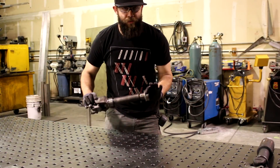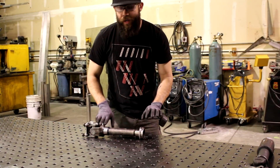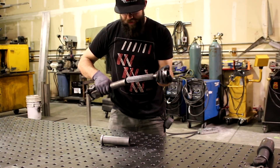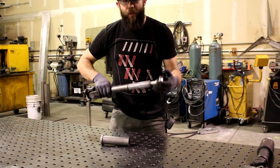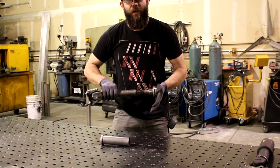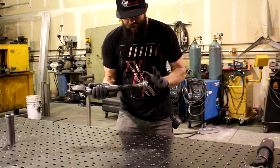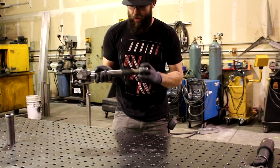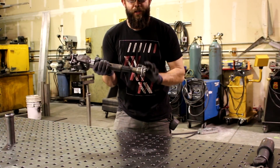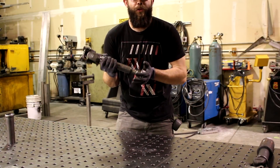This is what you're going to get when you order from Low Range Off-Road — it's $275. You get the U-joint and the Zerk fittings. This thing's pretty beefy; there's eight inches of slip here which is good for a rear end. For a front end it might not be enough — you might have to go with something like a 10-inch spline — but for the rear it should be more than enough. As far as I can tell this seems to be very high quality; there's zero slop in the splines whatsoever and everything looks up to par with what you'd expect.